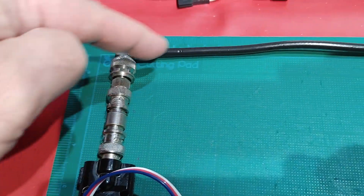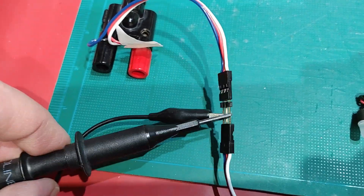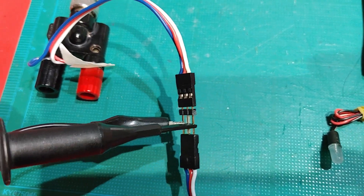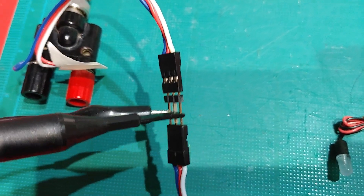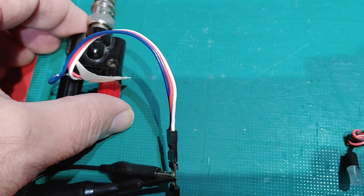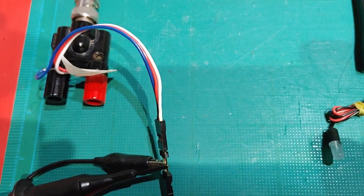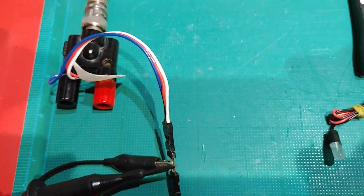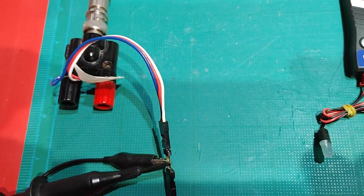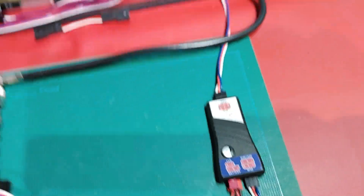So the signal will come out of the synthesizer through here, goes into the servo lead, and I've also got an oscilloscope probe connected here to the signal cable — so I've got an earth connection and I've connected it also to the signal lead — and that all allows us to view the actual signals on an oscilloscope as well. I also want to highlight some different waveform characteristics I've noticed with my SATO ignition module that weren't quite what I expected.